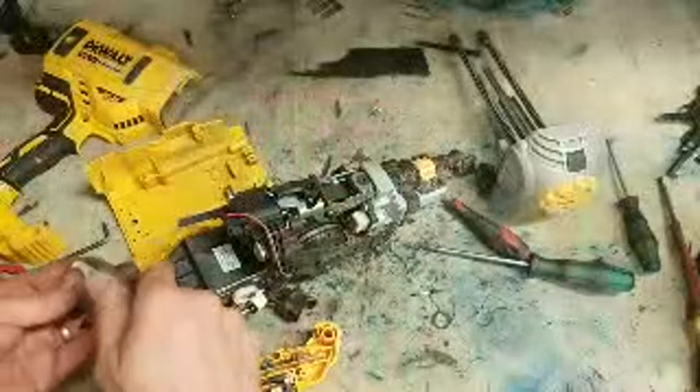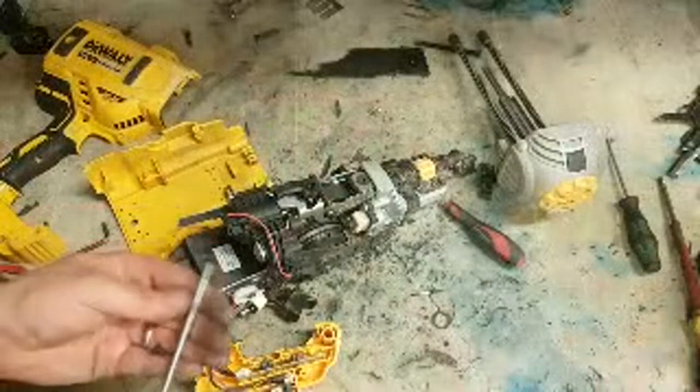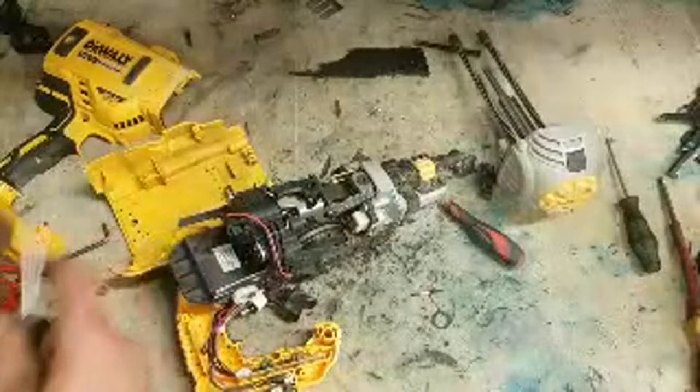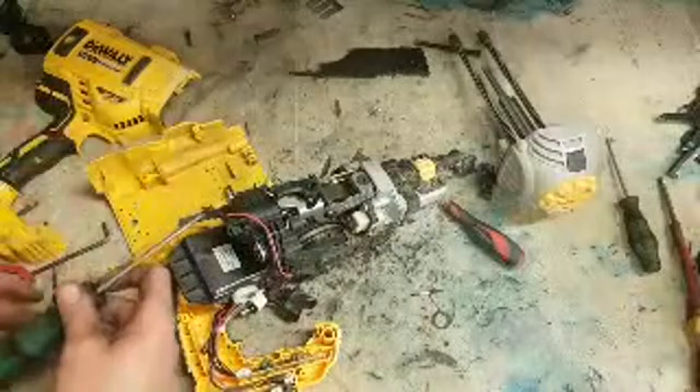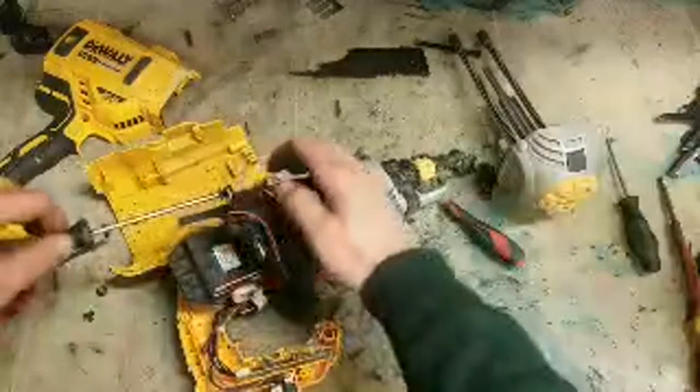These screws should come with Loctite, but they don't anymore. Put a wee dab on, because you don't want them backing out. But apart from that, there's not an awful lot to go wrong with these guns.